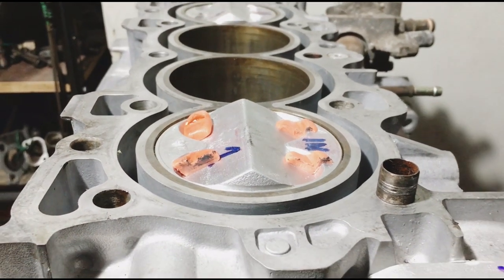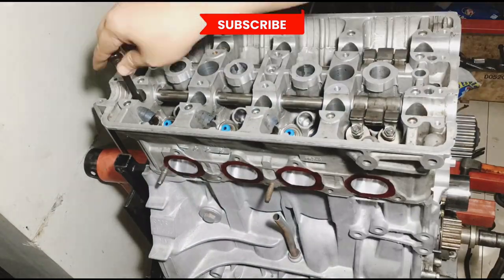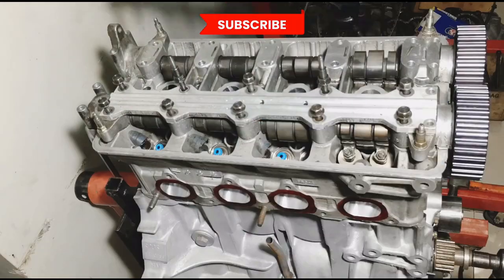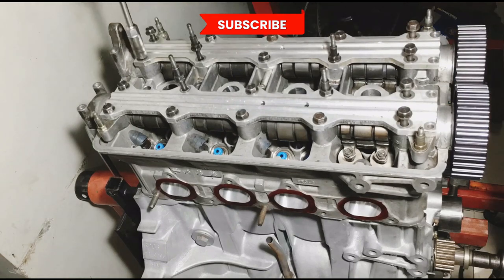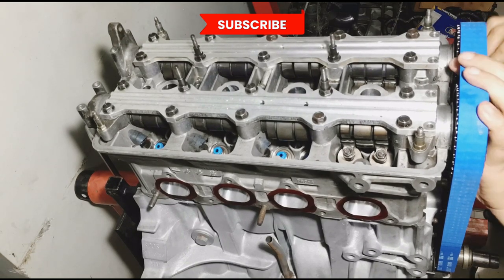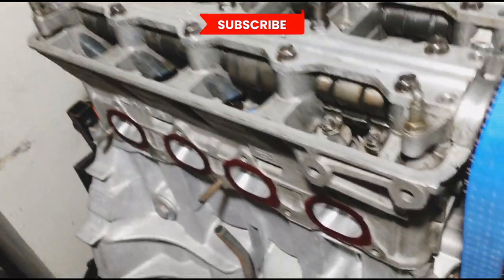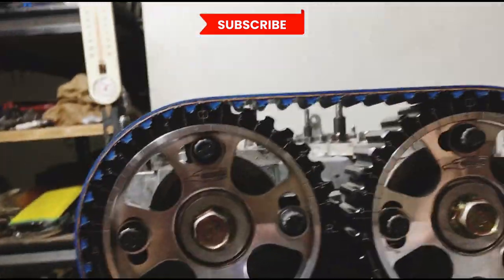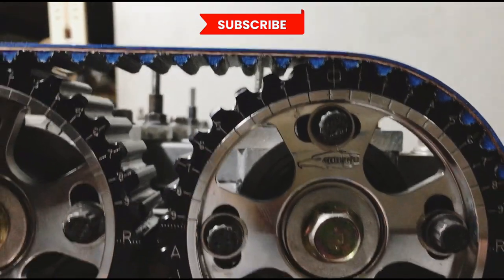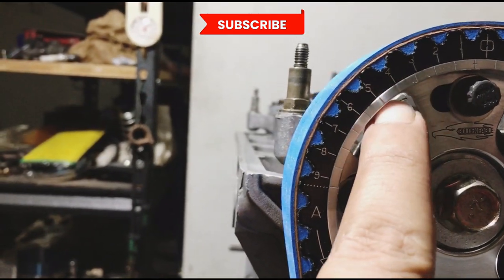So now on to the next task. We put clay again, and this time we advanced two degrees on the intake and four on the exhaust. Back to the head, the head studs hand tight, and then the cams, caps, rail. With clay testing, we go as far as three or four times removing and installing the head — that's a lot of work, but you gotta do it. Now after one full turn, the intake is advanced two degrees — you can see the number two is aligned. The exhaust is advanced four degrees over there, aligned.